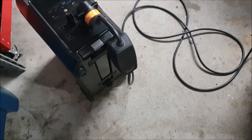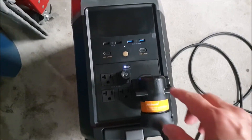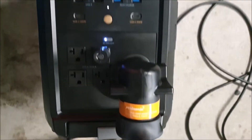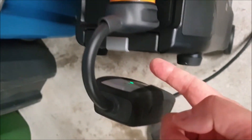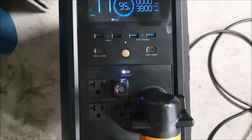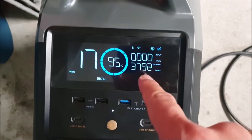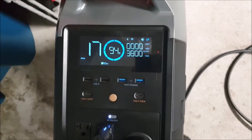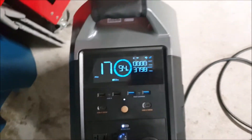I'm trying what everyone else has tried — well, not everyone else. What we have is the EcoFlow Delta Pro, and it is plugged into the 30-amp with the adapter, which you've seen online. We got the mobile charger, and the car's set to 32 amps. We got the grounding plug that's plugged into one of the ports, and it's pulling, as you can see, about 3.7, 3.8 kilowatts, and it will drain this entire thing in 17 minutes.